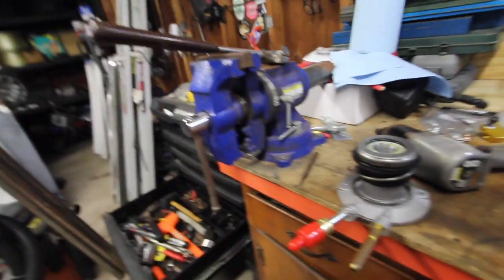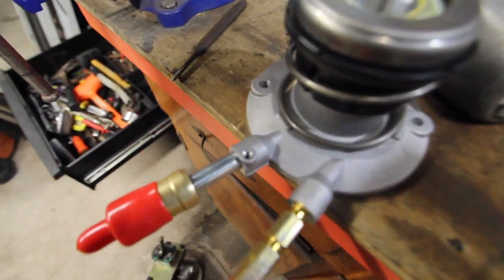Actually I've changed my mind — we're going to put the slave cylinder on first. I have been trying with this slave cylinder for maybe 45 minutes and I'm having a real hard time. What I'm trying to do is take a punch and take out that little pin, but I don't think I have the right size punch. So I'm going to wait until tomorrow and bring it to work — maybe one of the guys there has a good punch to get that out.